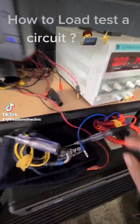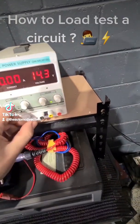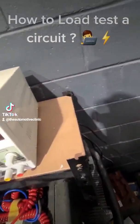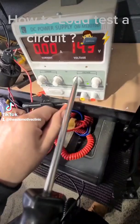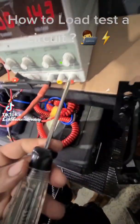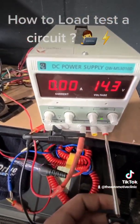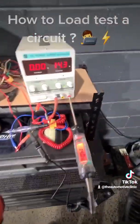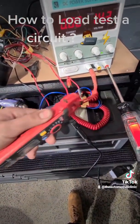The other option is LED test lights. Although I just have to hook this up slightly differently — LED test lights have their time and place. An LED test light is good for computer circuits, somewhere where you really want to be safe. An LED test light has very very minimal current draw. As you can see it's reading 14.1 volts but next to no current draw — not even readable on the meter.